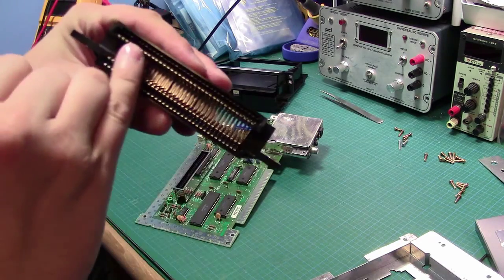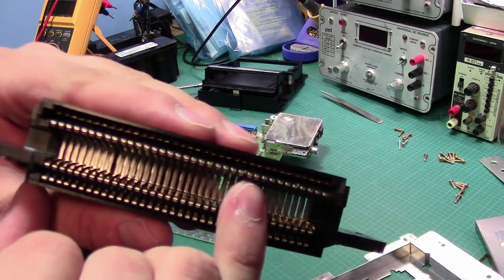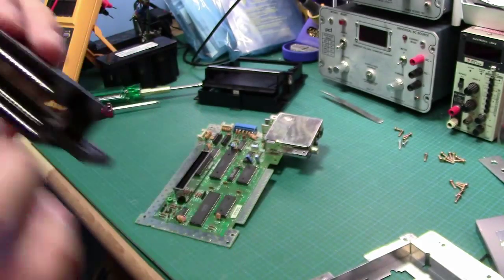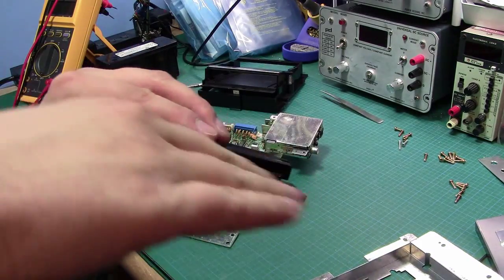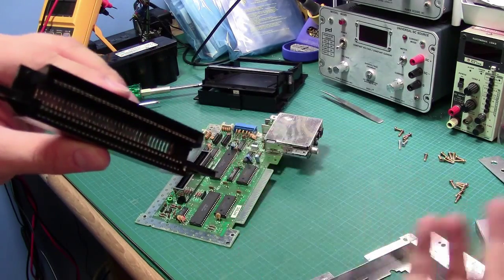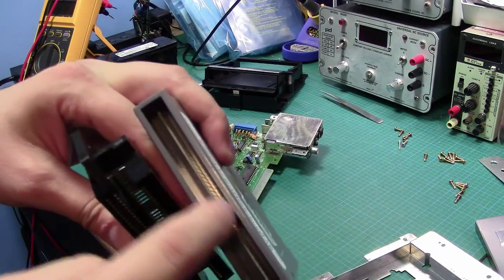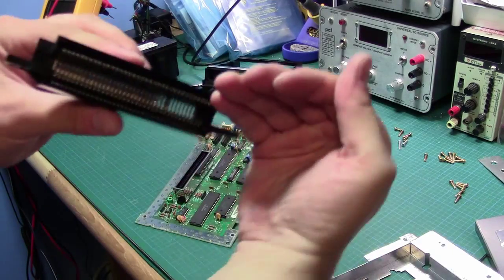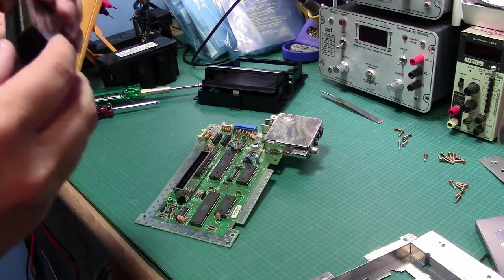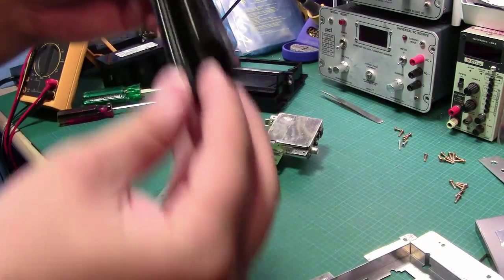That's interesting because if I look at the bottom row of contacts here, I don't know if that'll come through, but they don't seem to be at an even level. It already seems like some of them are pushed down more than the others. So maybe that action of tilting the cartridge on the connector PCB, having that tilt down on these things, pressing maybe unevenly, has caused them to wear unevenly. Maybe our unit doesn't have this problem, but I could easily see how that would happen.